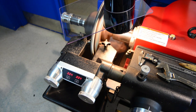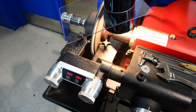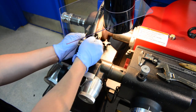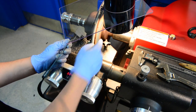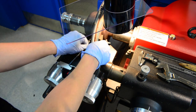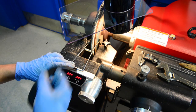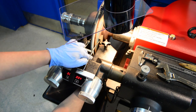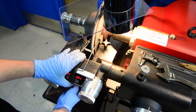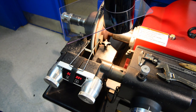Pull the lever to neutral to stop it, then turn the machine off so we can put our clamping silencer on. Take our silencing clamp and stretch it over the brake rotor, making sure that the dowel pins are in front of the cutting bits. Then take the band clamp, wrap it around the cutting head, and velcro it to the machine so it won't fall off. Start the machine back up and finish the cut.